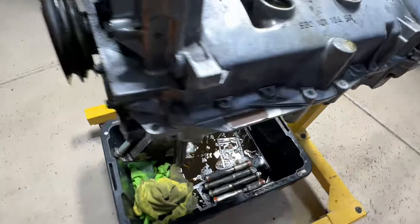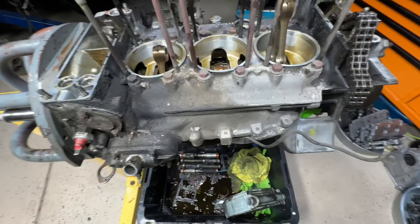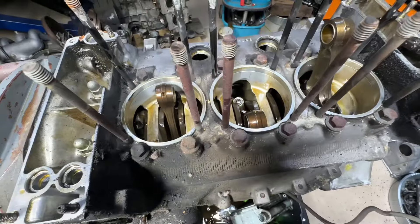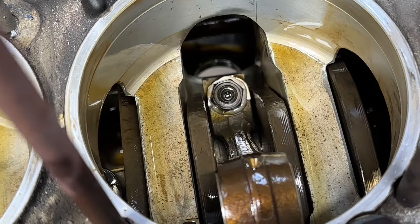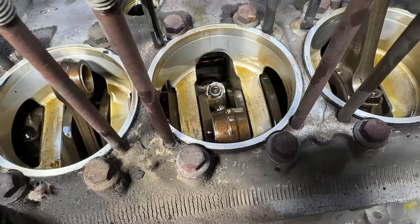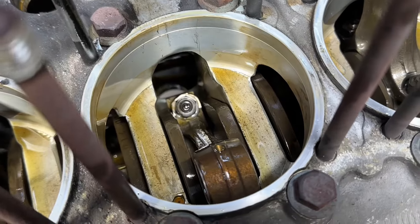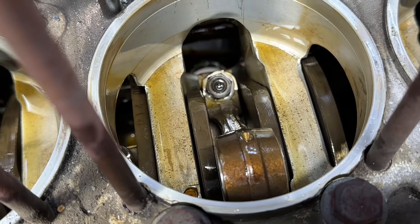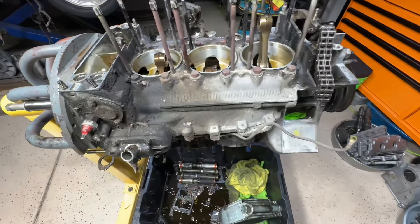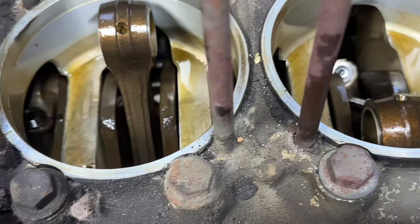So this is the 3.2 — we're going to do a top end on it at 98,000 miles, that's about right. The other thing we're going to do is change the rod bolts, because this is another common problem with the 3.2. We're going to change those out to some ARP hardware, and then at that time we'll look at the bearings and see what they look like. That's the weak link on a 3.2 also. Valve guides wear, and those will stretch and give you problems later. So they say not to run the 3.2 at high RPMs for long periods of time.